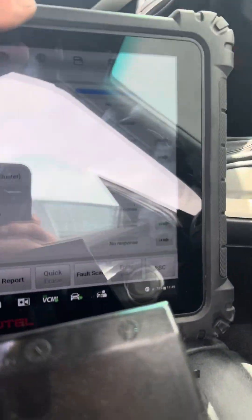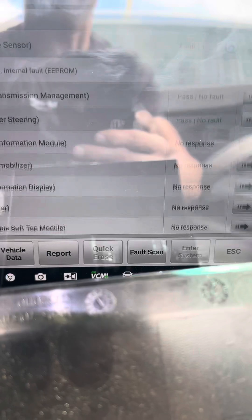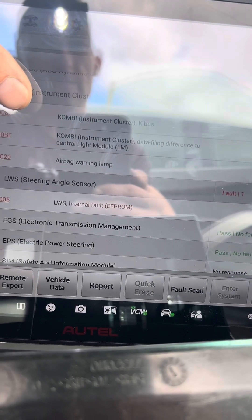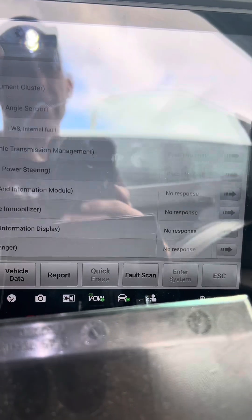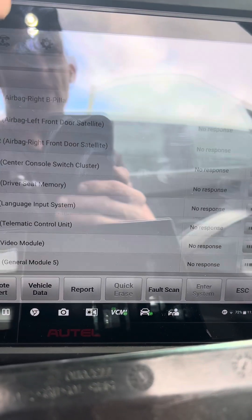So these are always fun. If you can see it, the glare — not much communicating. But from the instrument cluster, that is the master or gateway for your K-CAN communication. K-Bus and so on. There's no topology on this one, but as you see, there's nothing communicating.